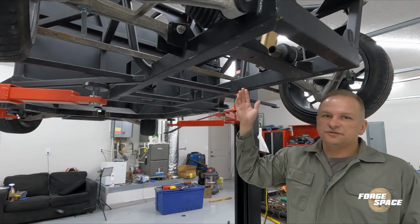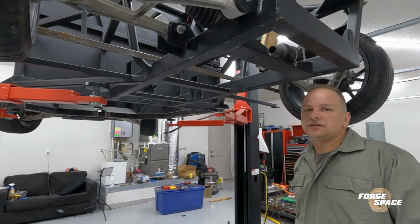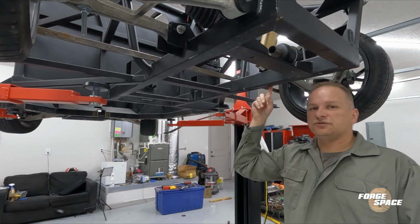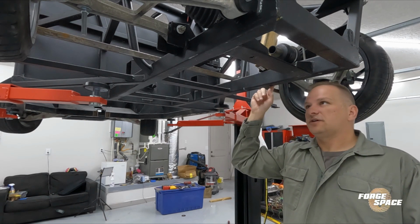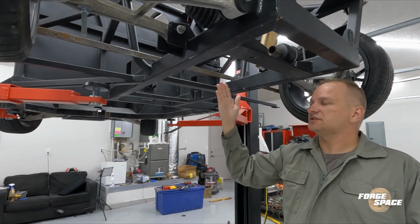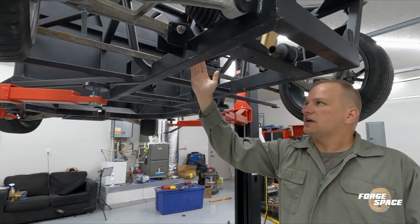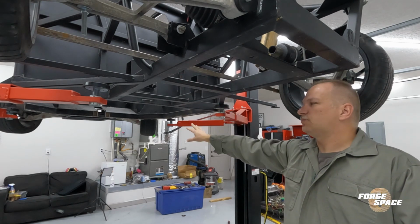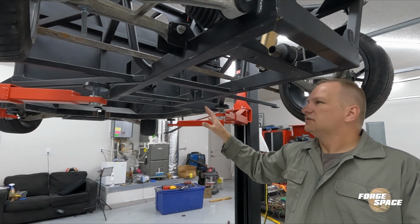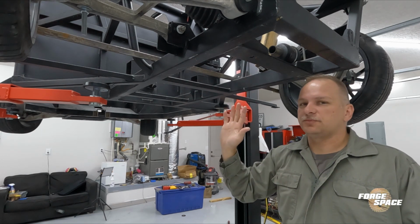So first thing we gotta do, we gotta clean off this surface right here, so we can go ahead and weld in our cross brace, and we're gonna use the same 2x3 frame rail to come across here. We could probably go with something smaller because it's also gonna get the battery rail, but that'll be fine because that's already what it is, and we're taking a bunch of weight out for what was there from the frame itself. Might as well just go on the little bit heavier side right here, and we'll be in a good place.